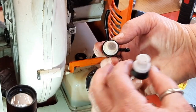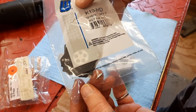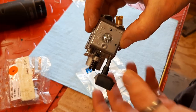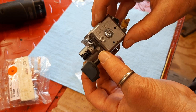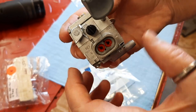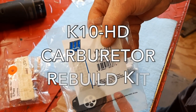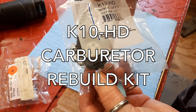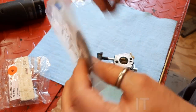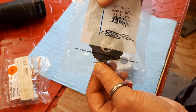So I went ahead and bought a new tank vent — not sure if that had anything to do with it — and a carb kit to rebuild this. It's been 20 years and this thing has been in great shape. This is an actual Walbro carburetor, an HD-28A. The kit for that is the K10-HD. Although the needle probably matches some others, this thing's 20 years old, so I decided to just go ahead and buy the complete kit and replace everything in there.